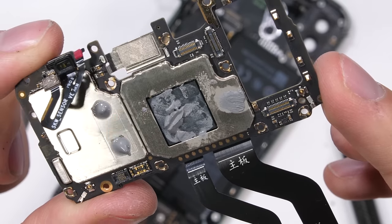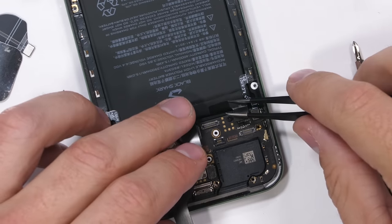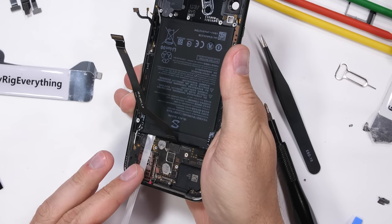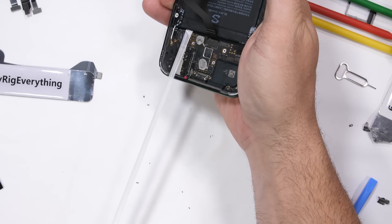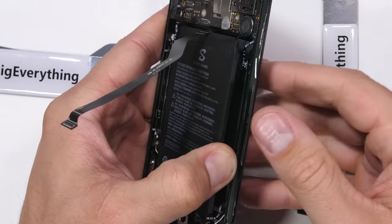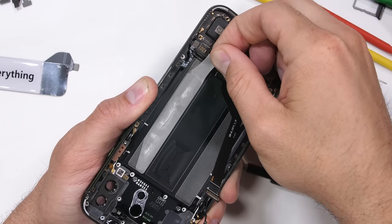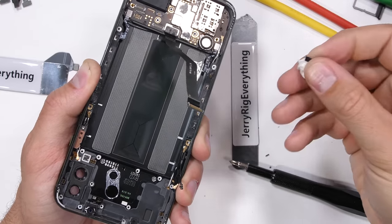Here's an up-close look at the thermal paste over the processor. The battery is upside down — and yep, it is. There are two magical pull tabs down at the bottom under the battery. The first pull tab broke, but the second pull tab was very successful. One out of two ain't bad. I'll commence the pry of shame and lift the battery out of the cavity. It's a large 4,000 milliamp hour capacity that says 'do not remove' — oops. The pull tabs under the battery are a pretty fantastic little invention. As the adhesive stretches out, it loses its stickiness and allows the battery to basically fall out of the phone without any force, as long as the pull tabs don't break, which is pretty common.